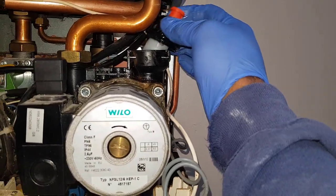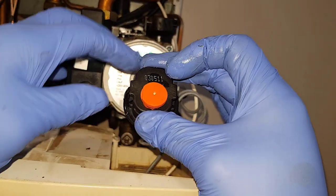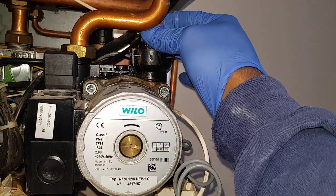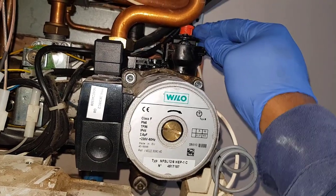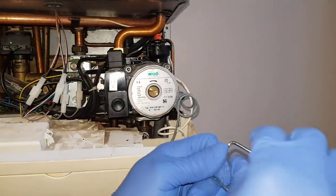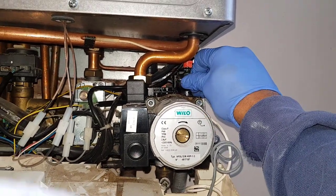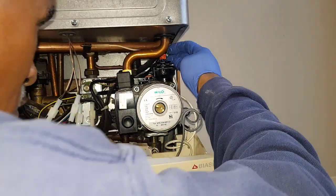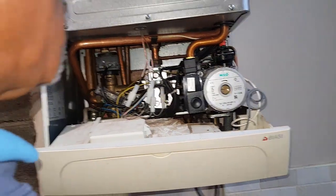There. It's going to go in like that because the pin when pushing is going to go across these two sides. I'll get my new clip, put a bit of silicone on that as well, and then insert it in — and that's it. Make sure that's open because you want to obviously let the air out through the air vent. Then we're going to fill up and see what else is going on.